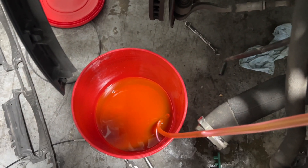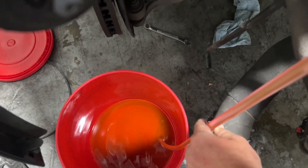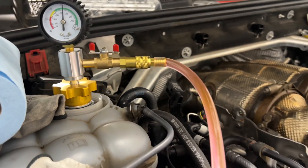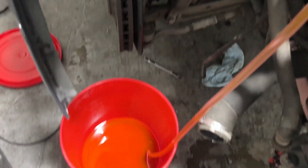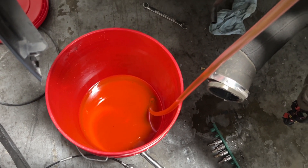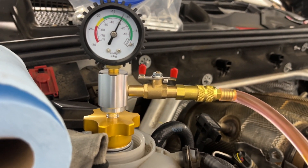You've got to watch it, because it'll suck this thing dry before it's had a chance to fill the whole system. So you want to make sure that your little brass filler stays on the bottom, and that you just allow this sucker to fill right up. It's just sucking up coolant from inside there, pulling it up — it's got a little screen on the bottom to keep any debris out. I'm actually reusing the coolant that came out of it, because it was a really low mile. But as this approaches zero, that'll let you know that the system's full.